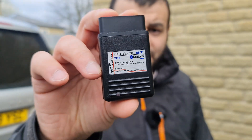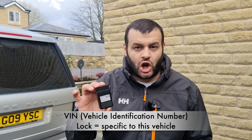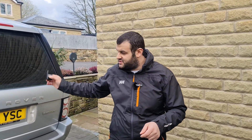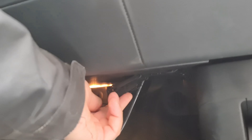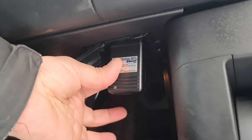This is a Land Rover one — Land Rover Range Rover — and this tool is specifically made for this vehicle and not for anything else. This is not the expensive pro version, but this one is VIN-locked, meaning it's specifically for this vehicle and I cannot use it on a different L322. Now let me show you where you plug it in. If you go into your vehicle, underneath the footwell there is a cover, and you have access to plug your OBD2 in like so. After plugging the OBD2 into the vehicle, you now have the mouse and keyboard for the computer of the vehicle.